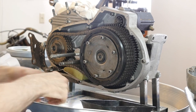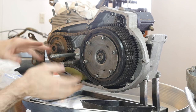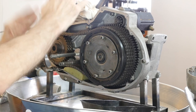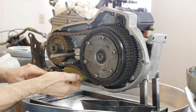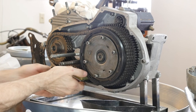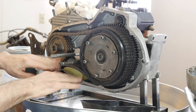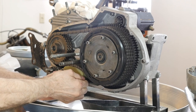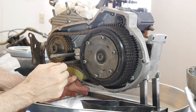What the spring does is it pushes down — that's what you want to do. You don't want harmonics forming in this, especially with a lumpy two-cylinder motor, thump-thump. You don't want the chain getting into harmonics, so you can't have a spring-loaded tensioner — you can't on camshafts either. So instead, what you do is you have the spring pushing down so this thing just doesn't flop around as the chain flops around. There's a spec in the book — get that service book.